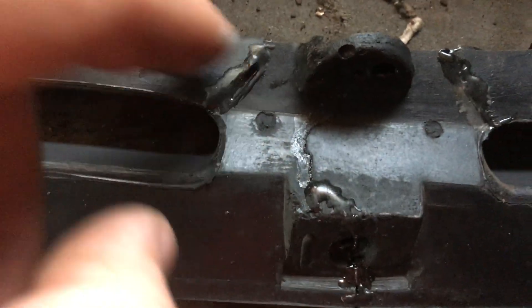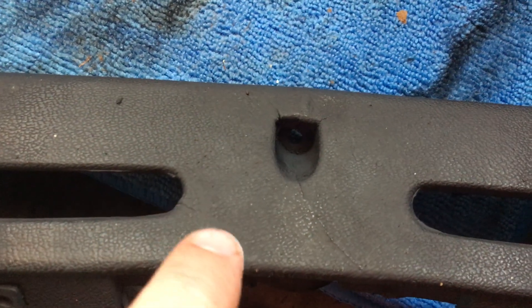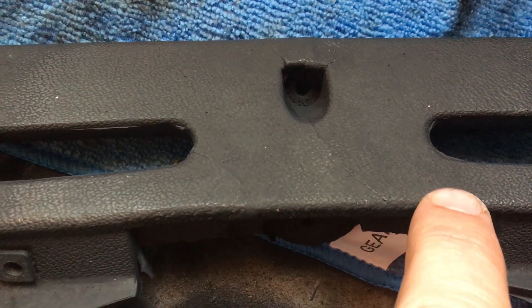I did that on all the support areas on the back. As you can see, I did it for each one of those cracks — one crack at a time with super glue, joined it all up, made sure the front was nice and even, then did the backing support with Bondic. There were massive cracks everywhere. The whole dash is flexible so it moves as you work on it, which is a bit of a pain.